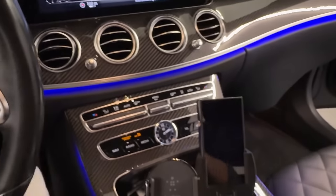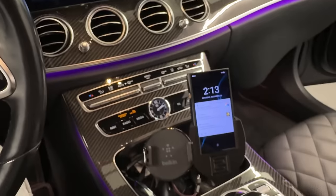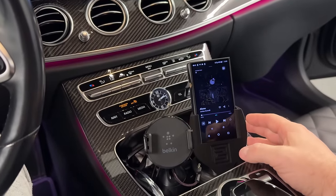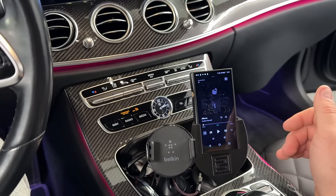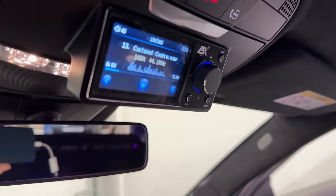There are a few niggly issues with this DSP I'm not the biggest fan of. Especially now, we have rear speakers that we used to run in differential. Now we can't run that in differential because it cannot process it. Or most of the things you want to control, like sub-level or little adjustments, you can only control from an app.